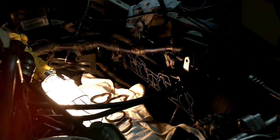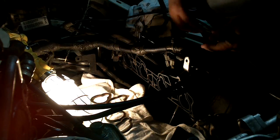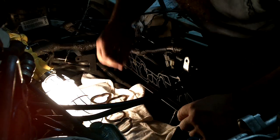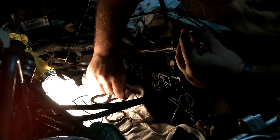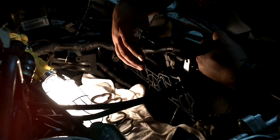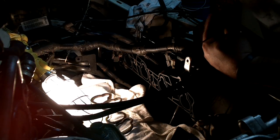The book says when you have this cleaned off - I just took the seals off, vacuumed out in here, took a bristle brush with plastic bristles and cleaned out all the junk in the little cavities that had built up over time, then suctioned out where my new rings are going to go. They suggest checking the head for warpage with a straight edge - same way we did the cylinder head, check across, check up and down, use a feeler gauge to see how much of a gap there is. Our new rings are very flat from where they've been sitting and got hot, so I don't think it's as huge an issue as with the cylinder head, but I'll check it anyway just to make sure part of our acceleration problem wasn't tied to this.